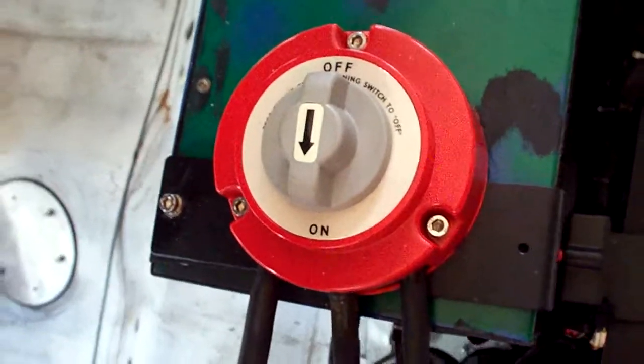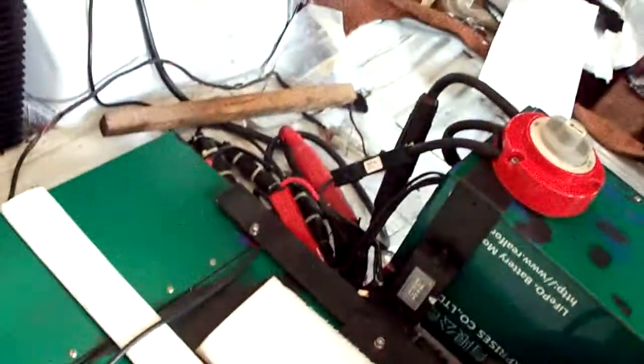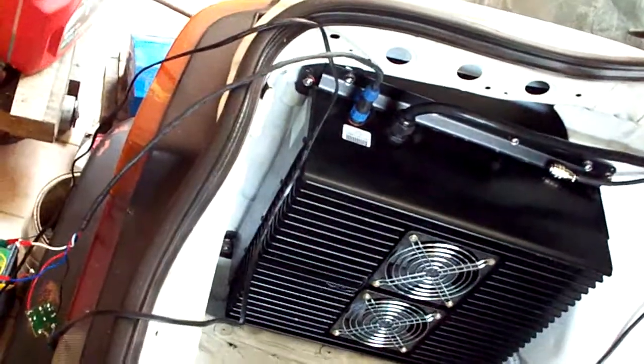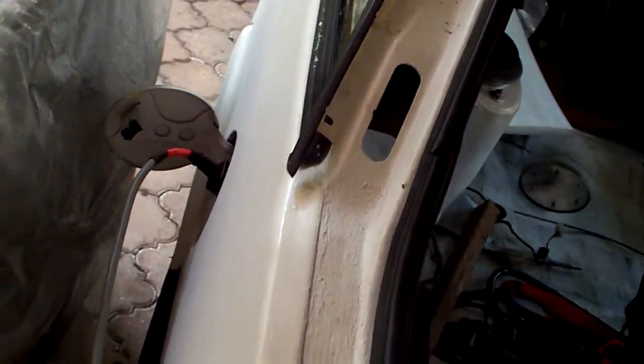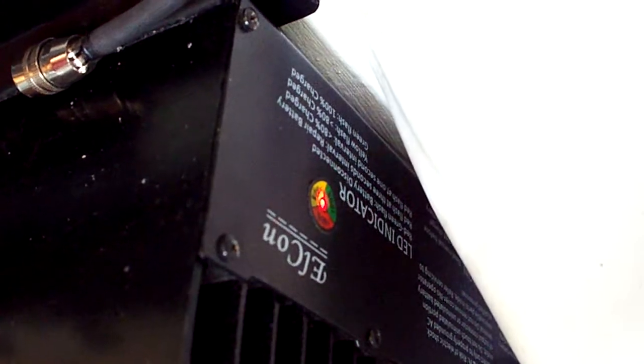So the battery pack is live. I've checked the voltage and retied everything down. I reconnected everything, went to the front of the car, and checked the voltage; all is in order. Checked and rechecked. The charger socket is in. So this goes here, and okay, normal, the fan turns on. The signal is not connected, so we'll feed in the 12 volts and see what happens.